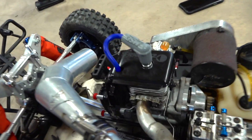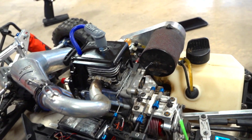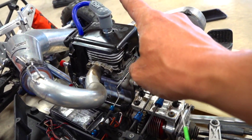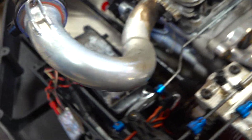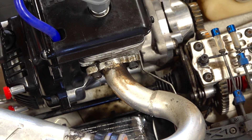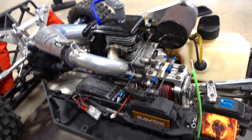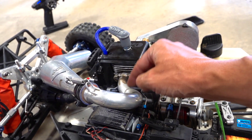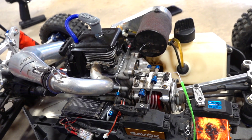Everett and I chatted more off camera. Look down here — this is the wrong pipe for this engine. I used to have a Widowmaker on here from O'Neill Brothers Racing. This is the same pipe, but it didn't quite match up. And if you look underneath — right down there, behind the drive shaft — it's wet. I have gas coming through the head, dripping from this point right here. So I don't have proper compression right there. It's not only the gasket that needs to be changed, but I need to change out this pipe so I have a proper seal. I'm darn sure that's why this wouldn't have started and kept going — that's the issue.